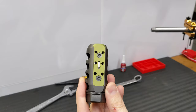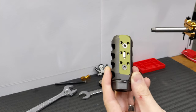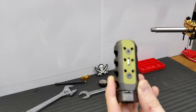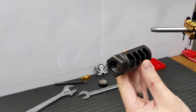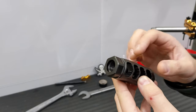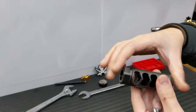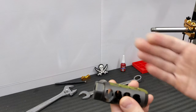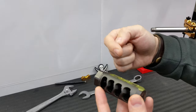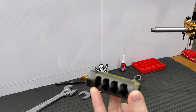Self-timing. I'll show you the ports in a second about tuning these top ports — they are totally adjustable so you can control the exact amount of muzzle rise you're getting, or ideally tune all your muzzle rise out so it stays dead on target after squeezing the trigger. The ports are quite a unique shape; you'll see they've got almost like teeth on the front — that's to help disrupt the gas that vents back. The first port in the brake is almost straight out the sides, and the theory behind that is you're creating a little bit of a barrier for the rest of the ports, which slowly get more aggressive on more of an angle.